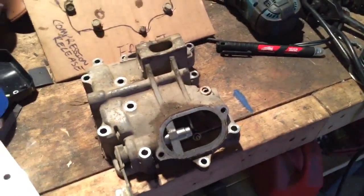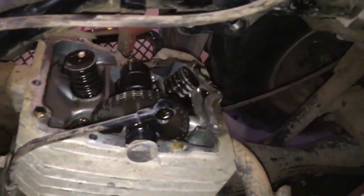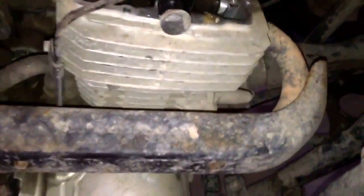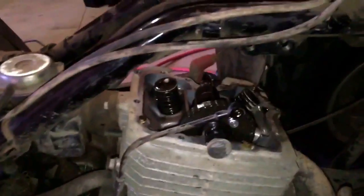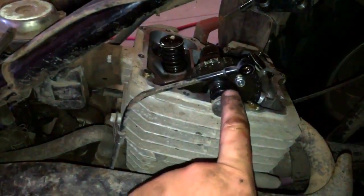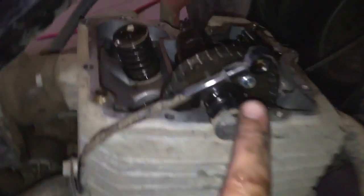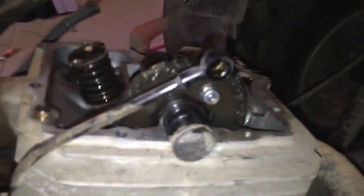So that's the rocker box right there off the motor, which brings us to the camshaft exposed on the motor — we're all ready to go. The next step is to disconnect the cam chain tensioner. Once I back that off I'll have the chain loose enough to hopefully slide the camshaft out. This motor's been apart before. You can see all this silicone inside the motor — that's when you know you've used too much silicone, when it's inside the motor like that. We'll clean all that up and put it back together right.